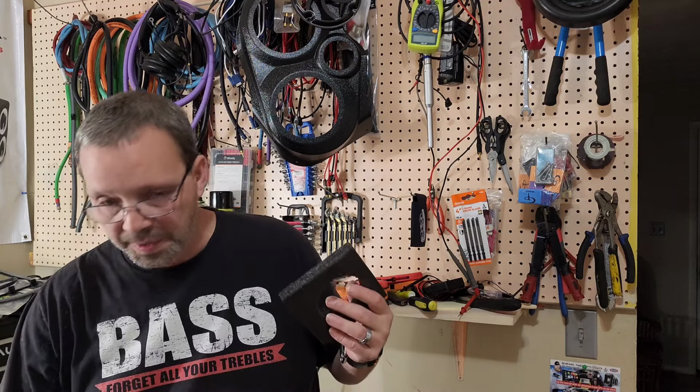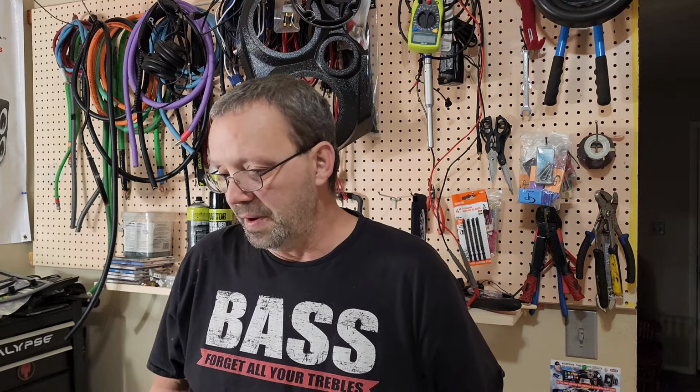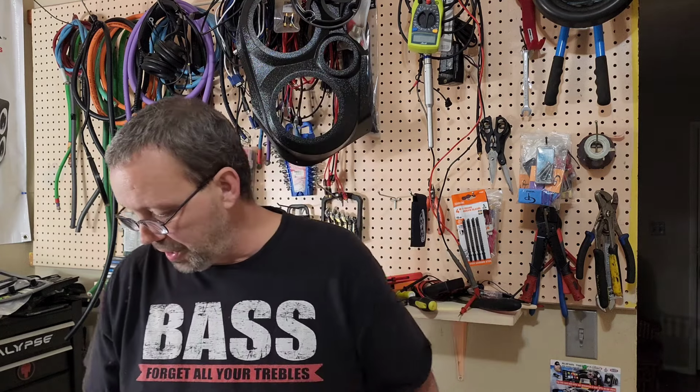Whereas designing a speaker to fit in a set amount of airspace enclosure and operate is easy. And it's marketable. That box can be sold, and millions of people can put it in different vehicles, and it can always deliver good results. Infinite baffle is infinitely complicated in application. And it's very difficult to market because there are so many variables that you can't plan for. It's so much easier to put it in the box.